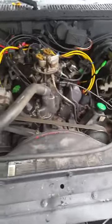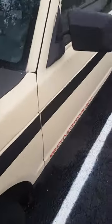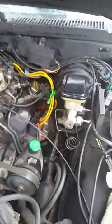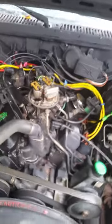Video number four — 1991 GMC Sonoma 2.8 liter 5-speed. Since the last video I just now got it started again. The only problem is I have to hold it to the floor. Fuel pump is brand new, relay is brand new, computer is brand new. Since the ECM is built into the computer, that's why I replaced it. Fuses replaced, and also replaced the relays just in case — those are brand new.